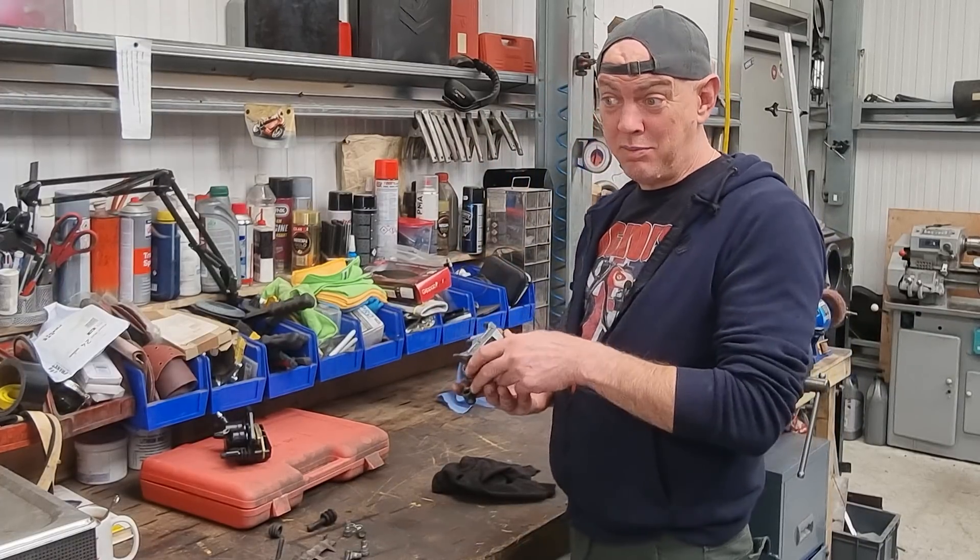I don't know if there's a replacement off some other model that fits - the D model is different, I know that, the whole spacing on that is 44mm. It's no longer available and I can't see one on eBay, and even if I did get one it's probably going to be minging as well, plus I'd need a service kit anyway. The only thing I can do at the minute is machine up the spacers for the front, get all the front calipers on and spaced nicely, get all that hooked up and bleed it. I can also do the clutch as long as that master cylinder is okay, which I'm hoping it's going to be.